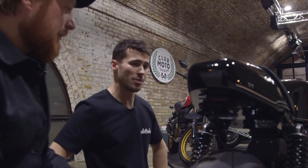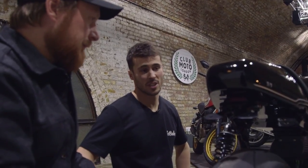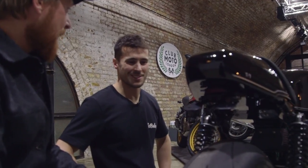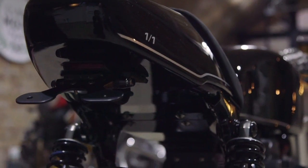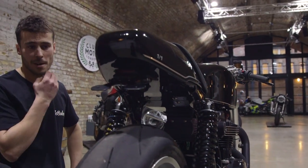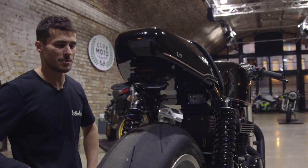A lot of the welds are fused so there's no heavy build-up — they're run through the English wheel or planished flat. They try to avoid filler, just a slight skim if needed — the aim is a good metal finish throughout. The bike could have been polished up in bare metal, but they decided to go with paint work, which is also done entirely in-house.